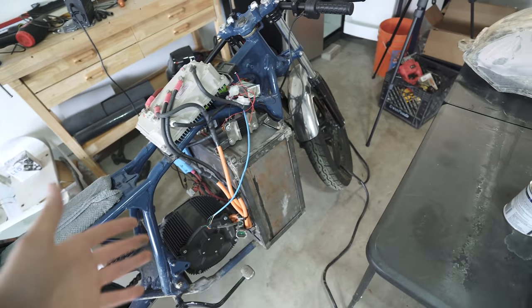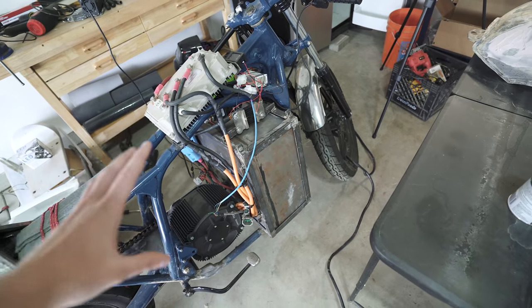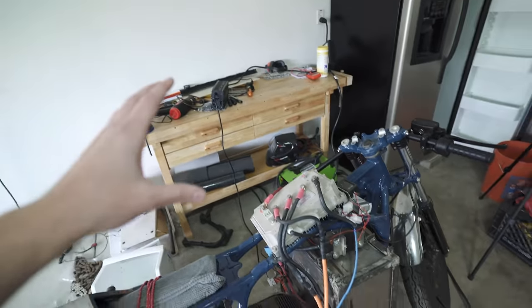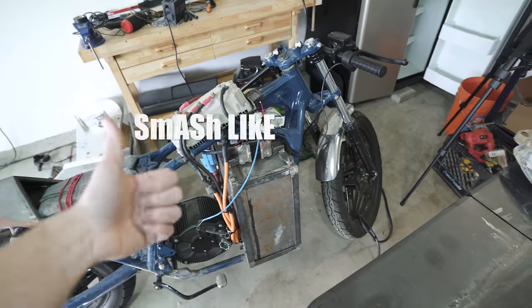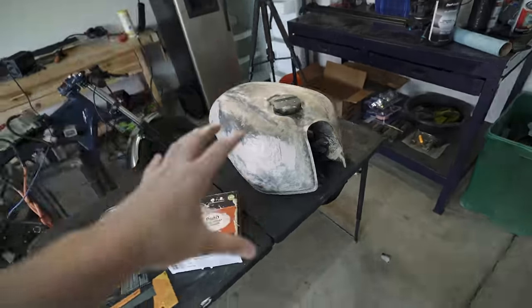You guys remember that the battery discharged itself over a couple months of sitting and down to 14 volts. So it could have permanently damaged the battery. We're hoping not yet, but Kurt is actually charging it through this discharge because the BMS wasn't letting it charge over 107 volts. So we're really hoping that all works out. But besides that, I'm getting started on everything else.